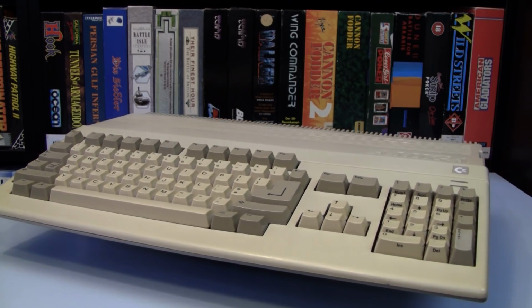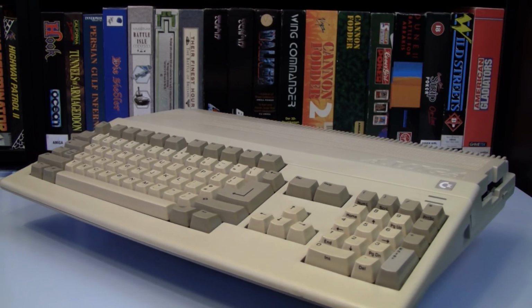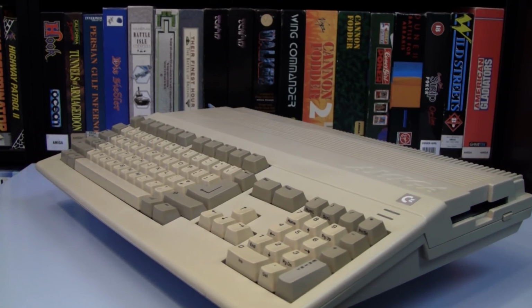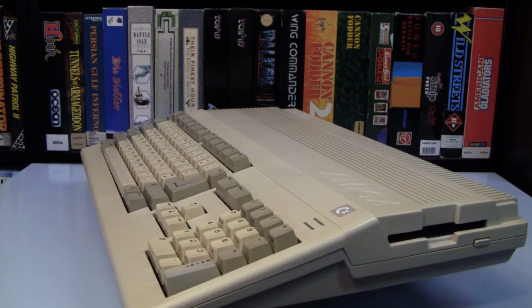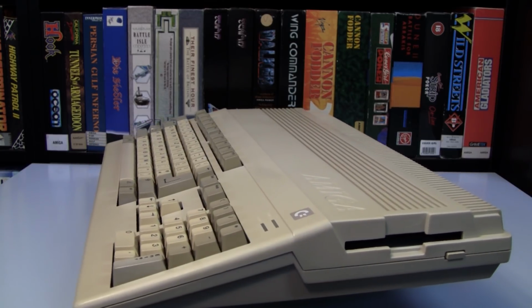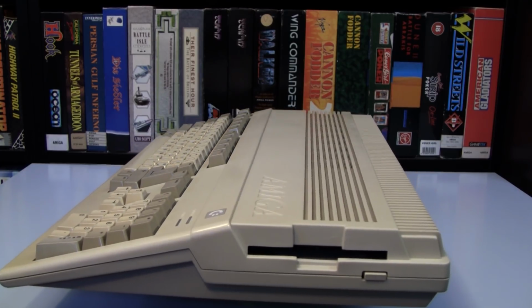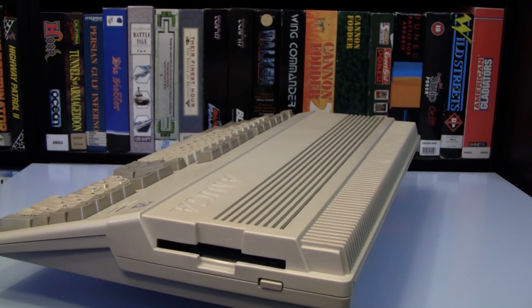Every time the computer starts up or gets reset, the Kickstart performs diagnostics and system checks. It activates all the components of the system plus every other device that might be connected to the computer, like a hard drive for instance or an extra floppy disk drive. And it tries to boot from every capable source, starting with the one of the highest boot priority first, of course.